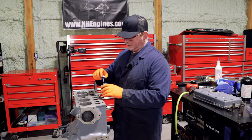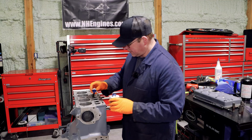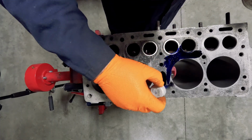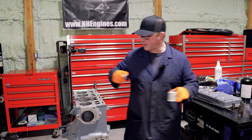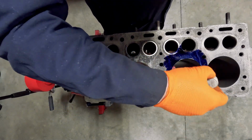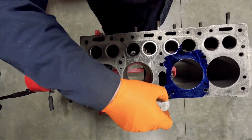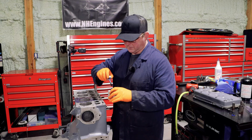You can get this anywhere. I think we probably got this particular bottle from Amazon 10 years ago. It goes a long way and it'll drip everywhere, so you don't end up with a load of this gunk dripping down your painted surface. Always put the brush in the center first. It comes off really quickly and easily with brake clean, but do you want brake clean on your paint? Probably not.